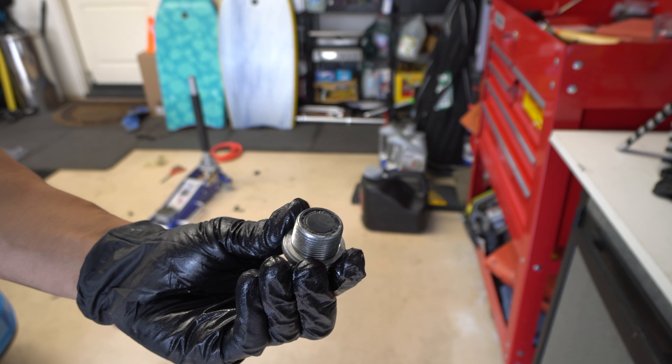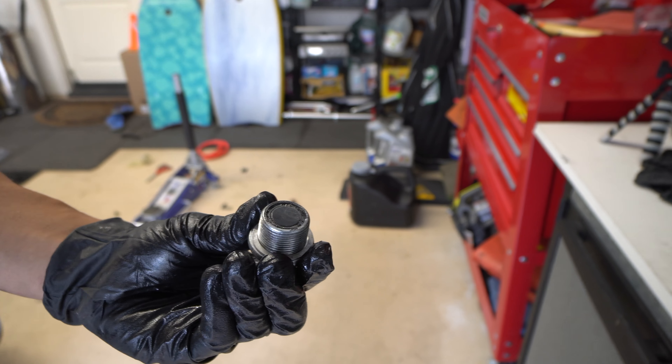This is the color of the diff fluid — you see how it's a very honey-ish olive color? The washer is in there, that's very good. So this is after 36,000 miles from the original OEM fluids. We're putting in this stuff here which is called the Motul 75W-140 weight, and this stuff is actually blue, so the next time we change it, it's going to be blue — he says Barney purple.